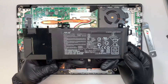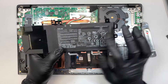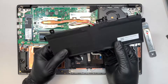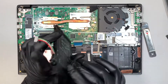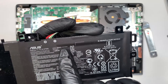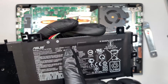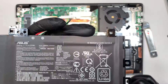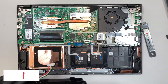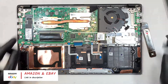If you need to change the battery because it's not holding a charge, or if the battery is swollen or has a lump on it, that is time for replacement. If you look here carefully, the part number is C21N1818-1. This is the Asus battery replacement part — I'll link it in the description below. You can check Amazon or eBay, which is where I usually source replacement parts.